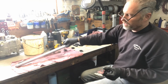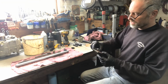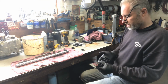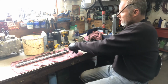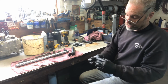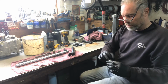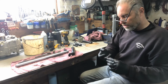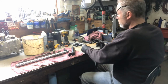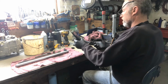And also when you put the leg back in the tube, there's less damage done to the seal. So that's it. I do the outside and the inside of the seal, or you can do the inside of the seal and the inside of the fork tube. One of the two, it's up to you. So that's what I do there. That way the lips are not damaged. And you can do the inside, like I said, of the fork tube.